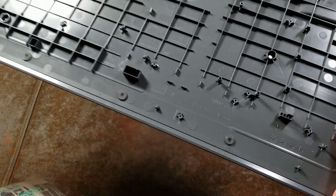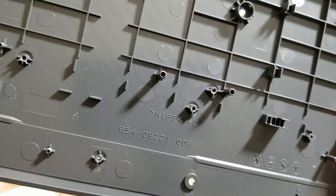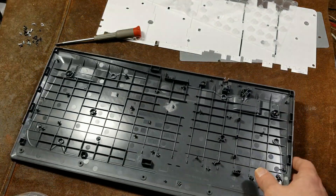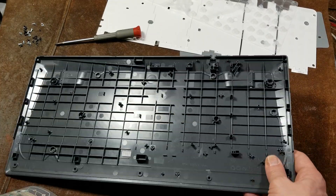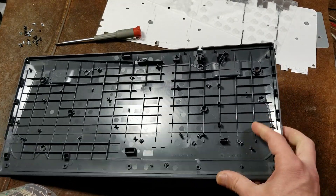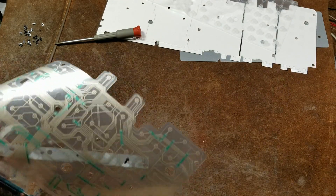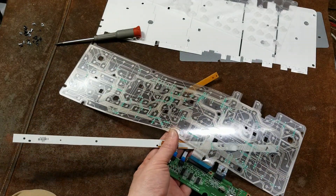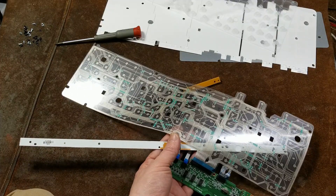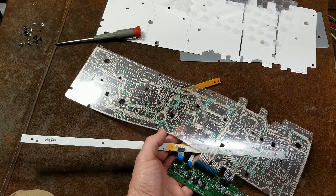We have this taken apart. The bottom tray is even worse than the ABS — that is HIPS, high-impact polystyrene. That's a pretty rare piece of plastic. This is basically styrofoam, just not foam — definitely pretty weak plastic. It's actually even worse than ABS as far as strength goes. Polystyrene actually has quite a few other applications which are fantastic, but solid plastic housings is not one of them.